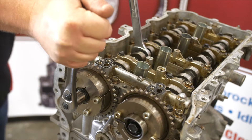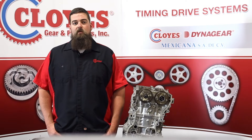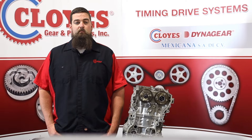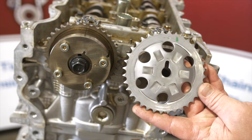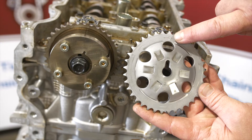If you plan on servicing the camshaft phasers, now is the time to do so. The phasers will only index onto the camshafts one way, so don't worry about losing your timing reference marks. When reinstalling the phasers onto the camshafts, torque the bolts to 63 foot-pounds while holding the camshafts with a wrench. You may come across a Toyota Technical Service Bulletin with a procedure that recommends unlocking the phaser before tightening the bolt — this procedure is not required when the timing cover and chain are removed during phaser replacement. One difference you may find on your engine is that the exhaust camshaft does not have a phaser; instead, you may have a regular camshaft sprocket. This sprocket was used in Toyota Avalon applications, and although it looks different than the phaser, the timing procedure is still the same.